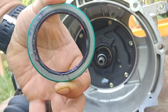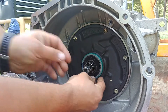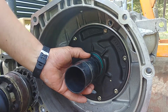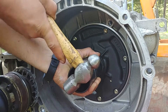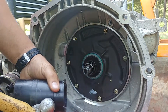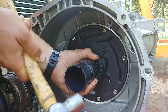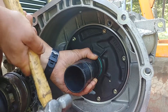Also put a little bit of grease on the back of the seal. Place the seal, make sure it's straight and level — don't let it go crooked. Here's the adapter and chunk of PVC pipe and a hammer. Just tap it in — don't go too hard, just enough pressure. Take the fitting out, check that it's all the way in. It will stop on its own — don't over-hammer. Make sure it's going in the same direction as the original seal fit.